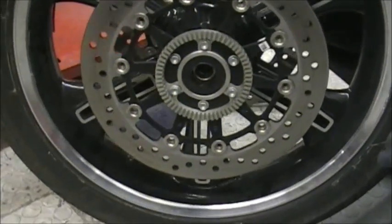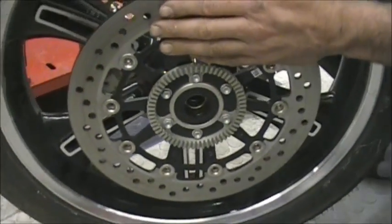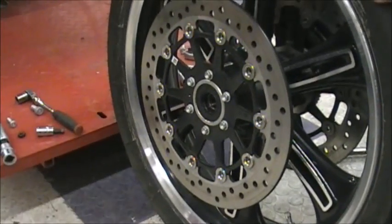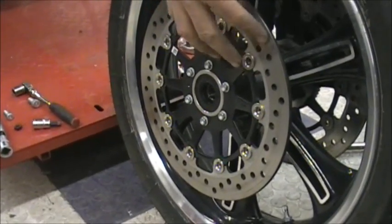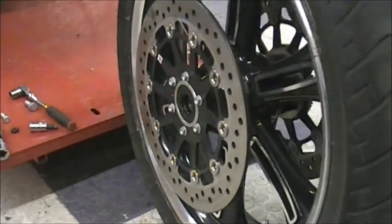The other thing is, if your bike has some miles on it, you want to make sure you keep the brake rotors on the correct sides. So in a bike like this, you want to make sure you keep this brake rotor on the same side, because what happens is your pads will wear and they'll get certain characteristics, the lines and all that wear into this rotor. You don't want to flop them side to side. You want to keep everything the same.